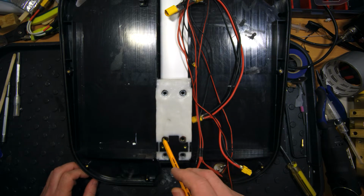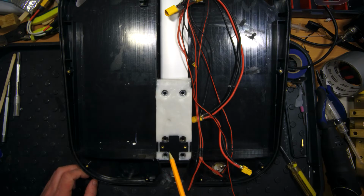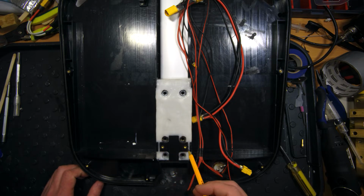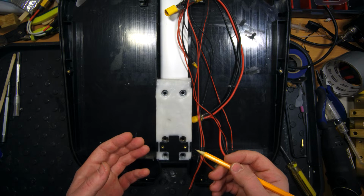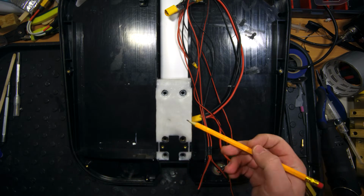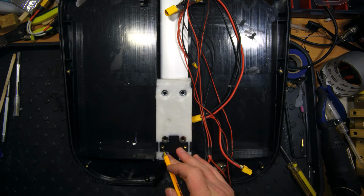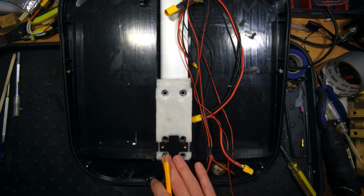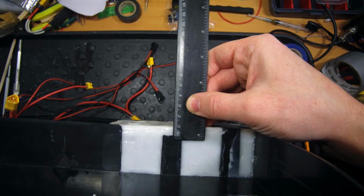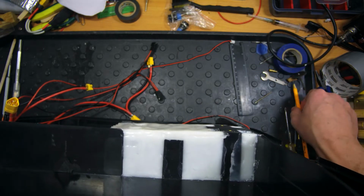Here I have custom cut washers melted in this area because the original wouldn't fit. Also pay attention that I've melted the washers with the thread in here to get rid of the wooden screws. Now the side cover of the wheel will be fixed very tightly and reliably, and the owner of this wheel can open and close this cover infinite times without any degradation of these places where wooden screws were located originally in this wheel. Thickness of this reinforcement plastic is about 10 millimeters, which is really good and reliable.